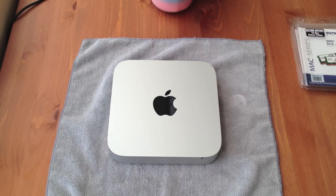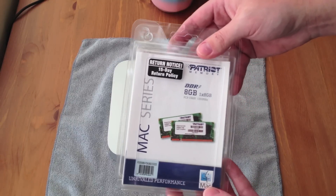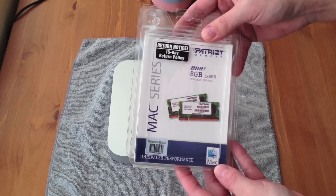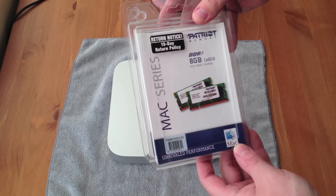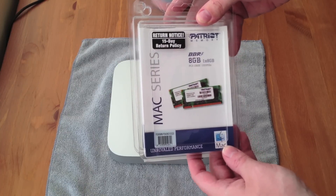As soon as I found this out, I was of course looking for the greatest deal, because 8GB RAM cards are still pretty expensive. Looking at Apple and OtherWorldComputing themselves, some RAM upgrade kits were closing in on $1,000 or more. But I was lucky enough to find Patriot Memory, which I've used in the past and it's never let me down — specifically their Apple Ready Memory, PC3-10600 running at 1333MHz, which is the exact type of RAM needed for this upgrade.